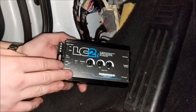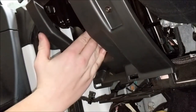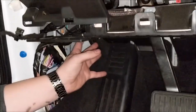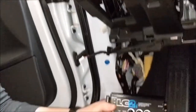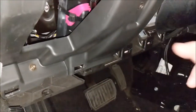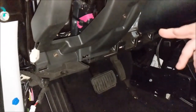This is the LC2i controller that we talked about in the beginning of the video. If you don't have the premium audio system or the UHFS system, we suggest mounting the LC2i controller right here where the amplifier would be. If you have the UHFS system, there are multiple places you can mount it — behind the dash, back where your amplifier is, in the front where your amplifier is, or depending on your model, there's extra room under here where the factory radio is. Most people who order the sub kit don't have the Ultra High Fidelity system, so we suggest mounting it right here where the Ultra High Fidelity system amp would be. If you have the UHFS and the amp, there's a big connector in there with a purple handle that has all your audio ins and outs for your amplified system, so you can pick up your signals from there as well.